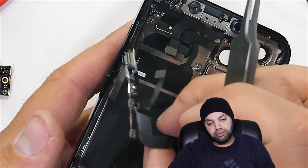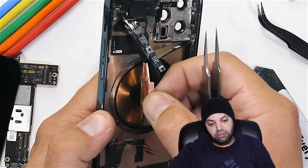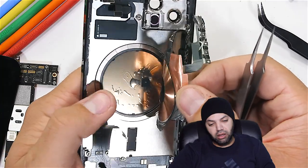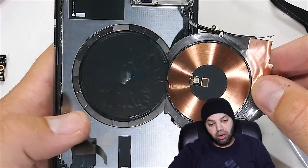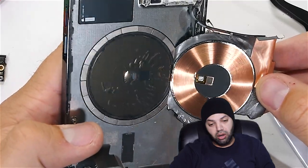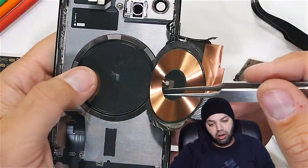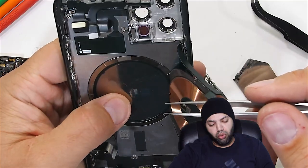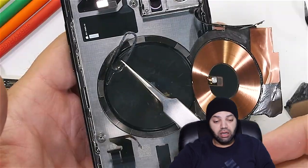Then finally, after everything, we get our first look under the wireless charging pad and glimpse this glorious array of circular magnets around the outside. It's rather brilliant of Apple to use magnets to perfectly position the 2 coils on top of each other. Instead of using one large circle magnet, it's actually made up of 18 smaller, more rectangular magnets. Apple has said that every single magnet used in the iPhone 12 is recycled, which is awesome.